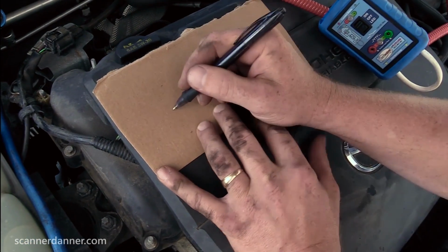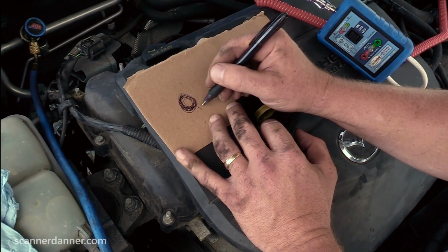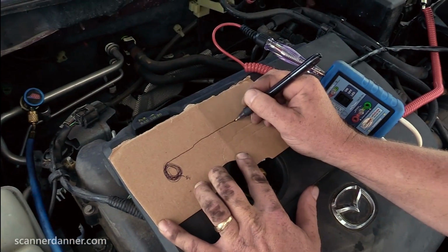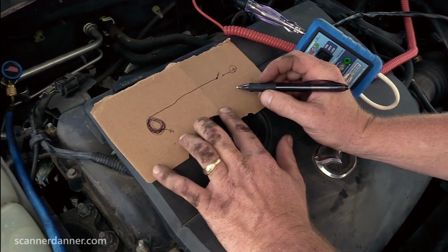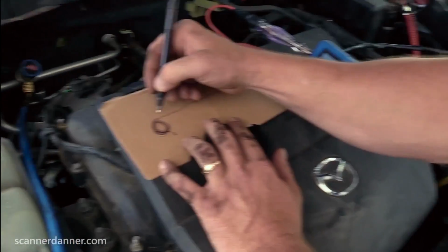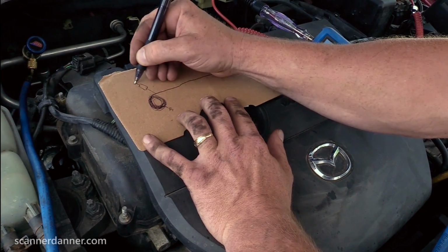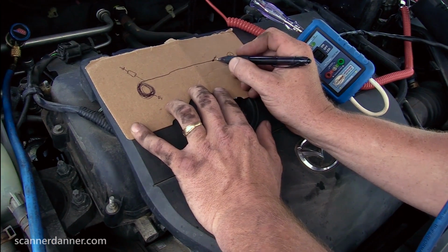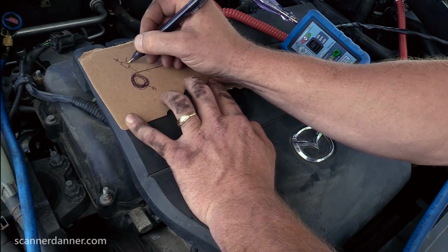All right. So the AC clutch, all it is a coil of wire, makes a magnetic field. It's an electromagnet. Has a ground on one end, and then this would come up to my relay. Okay? I'm just drawing the load side. Now what I'm doing is, well, we did two things. The last test that we just showed you, I put a test light right here, and I connected that test light to ground, and I flipped the switch on my tool. Flip the switch, I close the switch, send power this way, light lit.